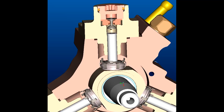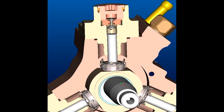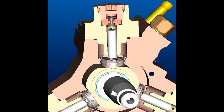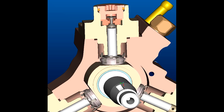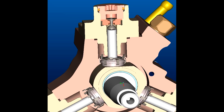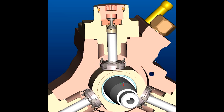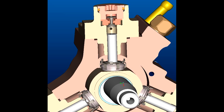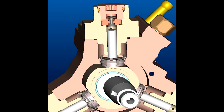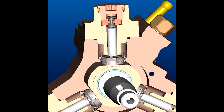I tested the turbo to make sure it was spinning freely and wasn't seized, checked the MAP sensor on the back of the inlet manifold — all were okay. Checked the inlet manifold for leaks and blockages, checked the air filter and the glow plugs to make sure they all work properly. Basically checked everything that would stop fuel and air getting into the cylinders.